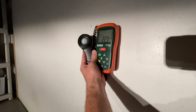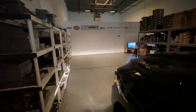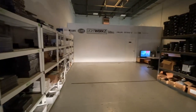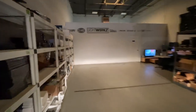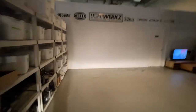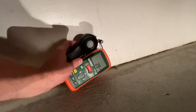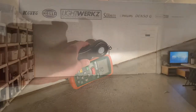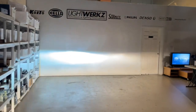We'll see where we end up once we're done with the LED conversion. Now we've got the fog lights on only, which will help us compare after the new SS3s are installed — we'll get them lined up to the same point and do a quick intensity test. The fog lights are reading about 85 lux.